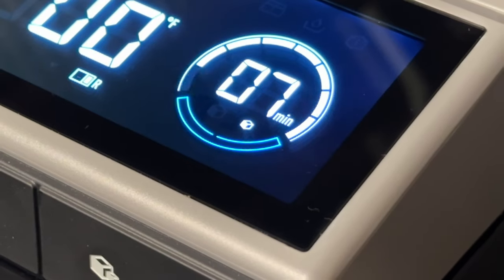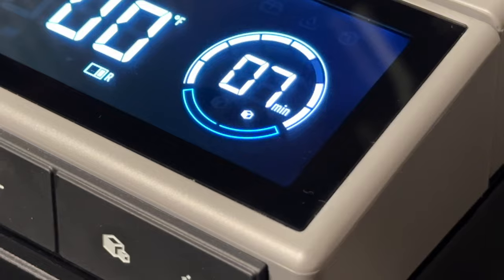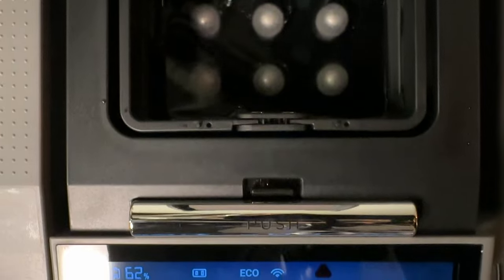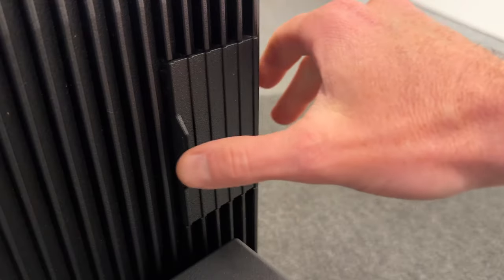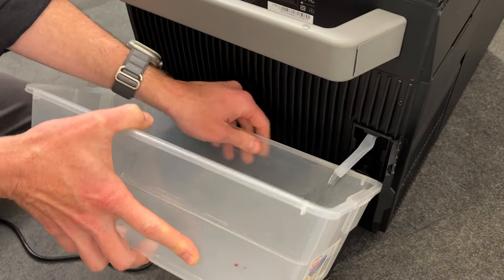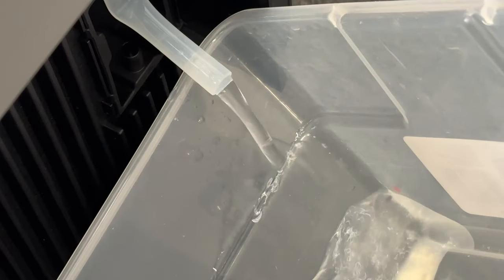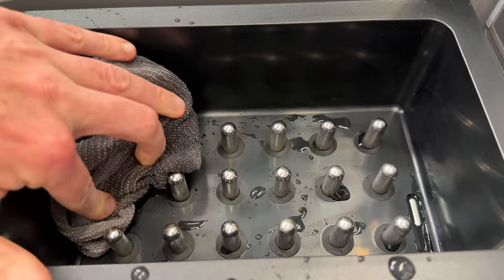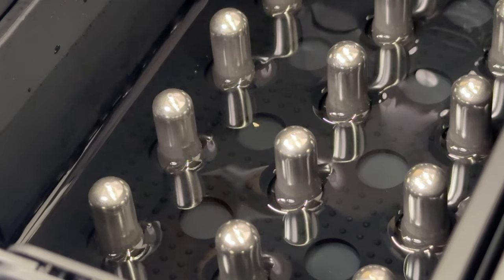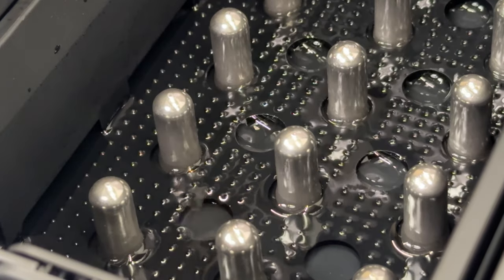When the Glacier is making ice, it will shut off the fridge or freezer so it can focus all its energy on making ice. That means you don't really want to do many batches back-to-back because it could cause the temperature to rise quite a bit. When you're done making ice, EcoFlow recommends draining it to avoid stagnant water — you open this door on the side, pull out the drain tube, and empty it into a container. You also need to wipe it out, as it never really fully dries by itself, which is a little bit of a hassle.